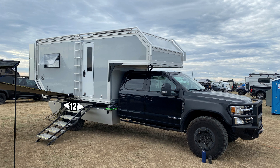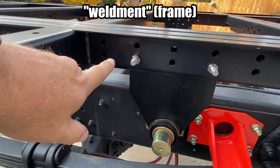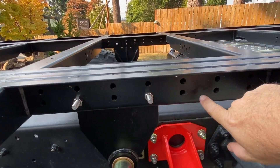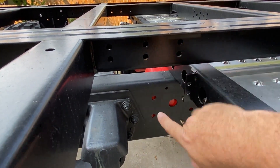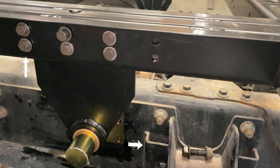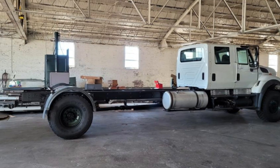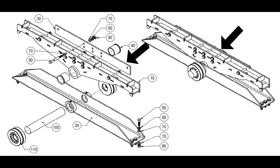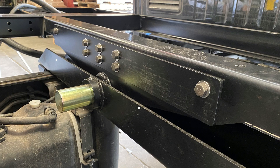What if you have a cabover with a 12-foot 4-point subframe due to the cantilevered weight forward of the forward-most crossmember pivot and you want a pass-through? Remember, the subframe weldment has mounting holes for a full 24-inch variety of positions that the side brackets can fit into. Simply mount the side brackets as far forward as you can — this will mitigate the frame twist differential as much as possible. Subframes built for extra-long trucks greater than 14 feet are all 4-point subframes or more. Stiffer plates are also used to ensure the integrity of the subframe weldment crossmembers where the crossmember pivots are attached.